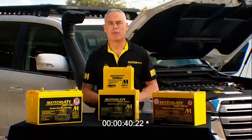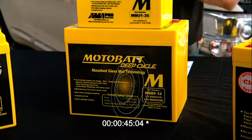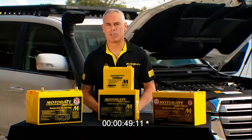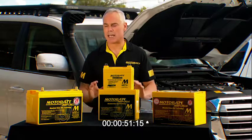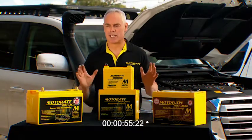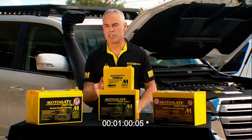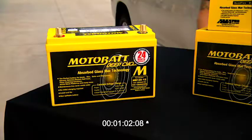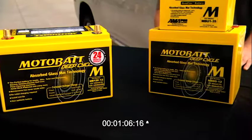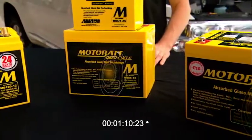If you're working with RVs, vehicle dual battery systems, you have a finite battery tray which will only accept a certain battery size. There's many own branded batteries on the market, BC31, BC27, BC24 sizes. Not all batteries are built the same, okay? Some of these batteries have less amp hour capacity because people are looking for a price advantage.